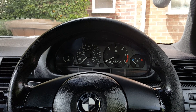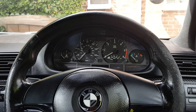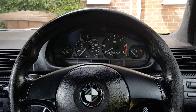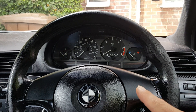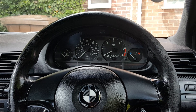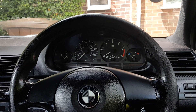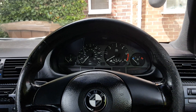This is a 2003 E46 - I believe this is the 2.0 TDI or TD. A bit of background: the ABS pump or DSC pump was replaced on this car. According to the owner, someone else had the car and it came up with an ECU internal fault. He got a secondhand pump with the same part number put in, and the same warning lights came on.